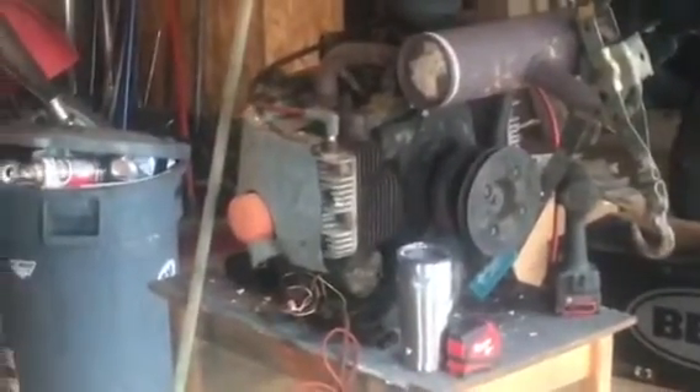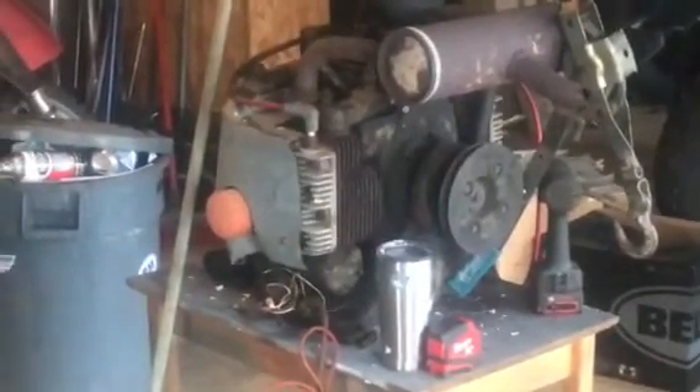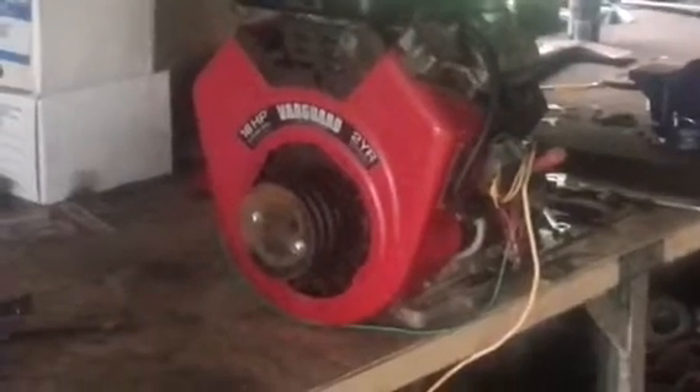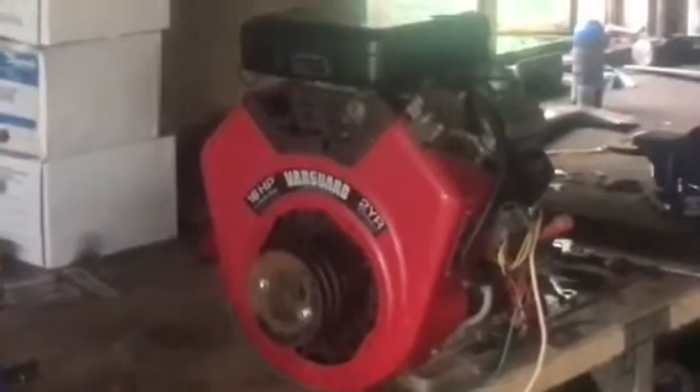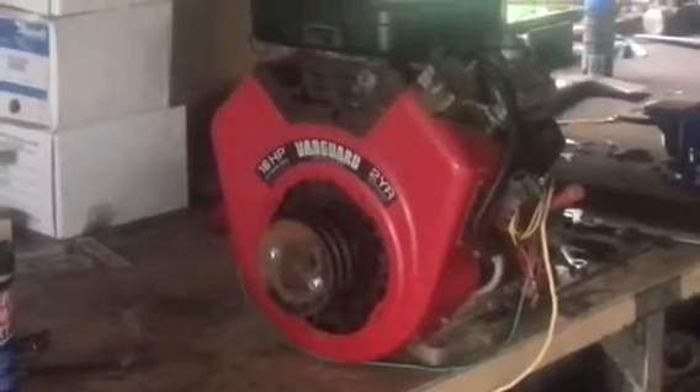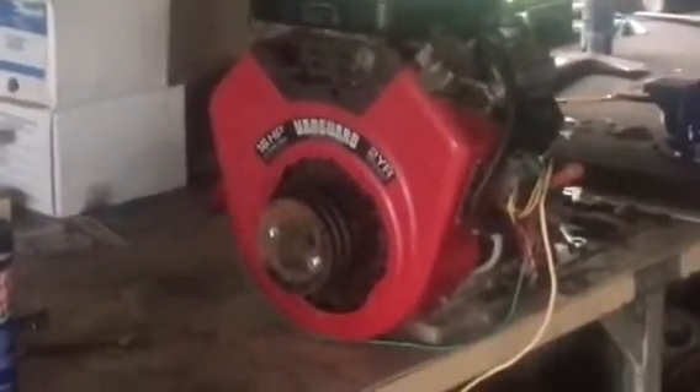As you can see I've got the motor out of this one - it's over there on the bench. It's been repowered once before and I'm actually repowering it again. I found this Vanguard at a guy's house for 50 bucks and it runs great. It does have a little bit of crankshaft play so I'm going to end up getting a new timing gear - whatever accessory they had on it before was pulling hard on the crankshaft.